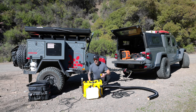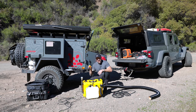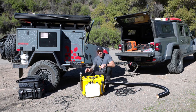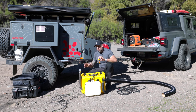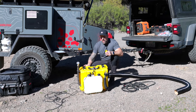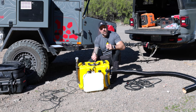Something to keep in mind: I was talking about the importance of having a solid electrical connection. Wherever you hook that up, make sure if you have kids running around that they are aware they cannot step on the power cord, because if the power source accidentally unplugs you could damage the heater itself. Can you use alligator clips? No — you want that connection bolted down, so that in case somebody accidentally bumps into it or the clips pop off, it doesn't disconnect. Make sure you have something ironclad that is not going anywhere.